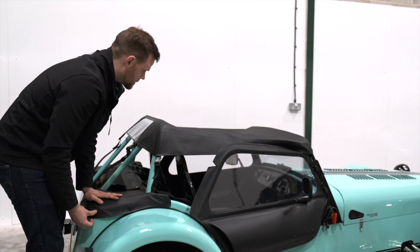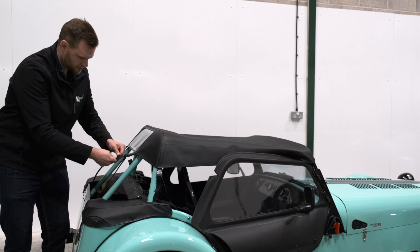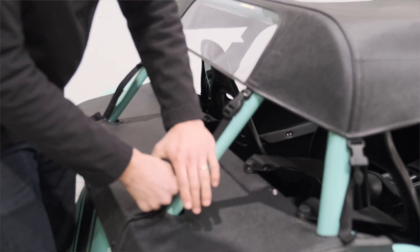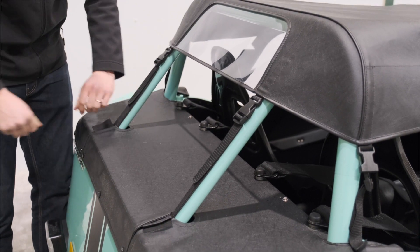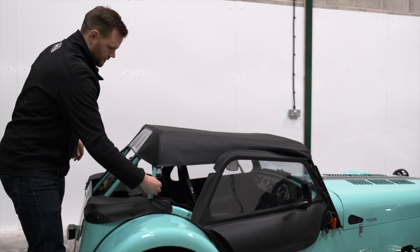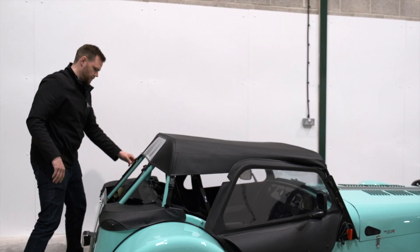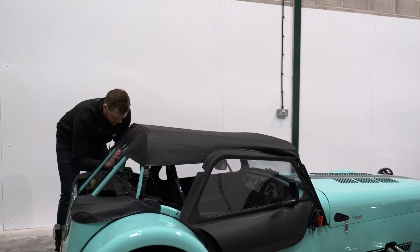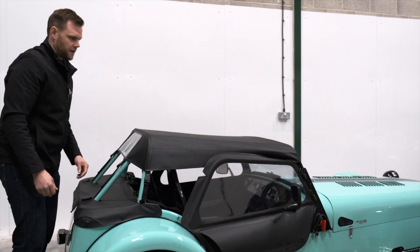At the moment these are out of adjustment, so the hood's still very loose. Just pull these straps down and use the flat of your second hand to help you get some tension. We don't need to pull these ridiculously tight, but just enough - you'll see the hood will come into tension. The side straps are the same; try and do them evenly, otherwise it will sit to one side. You'll see that it neatly pulls itself into shape. And that's it - that's your half hood on.